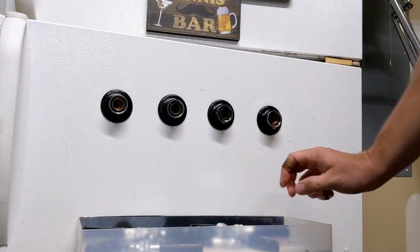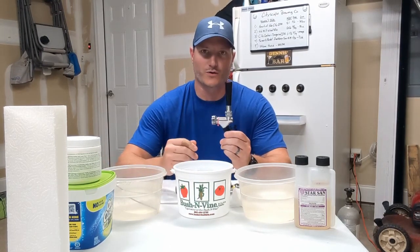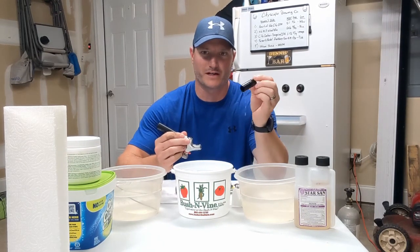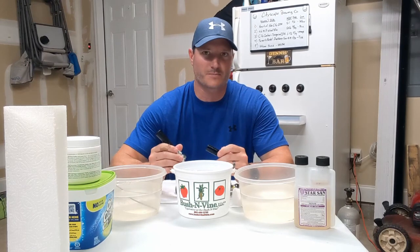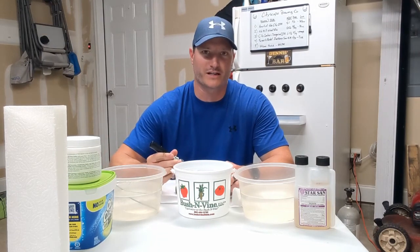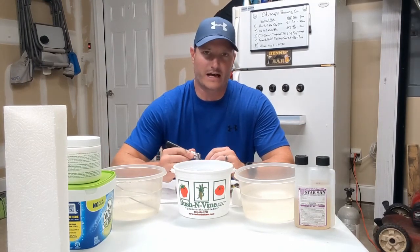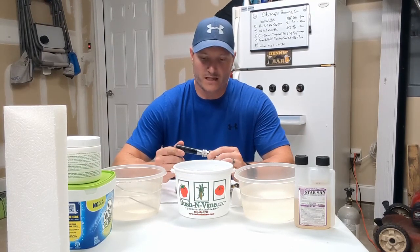So let's go ahead and start cleaning these up. Now that we got them all off the refrigerator we're going to start taking these apart. I use these little cap covers — they help keep little flies and other critters from crawling up into the faucets when they're sitting outside since this is in my garage. Sitting in the garage they're susceptible to getting mold or mildew, especially in the summertime. So you do want to do this pretty regularly to make sure you're not growing any nasties and eventually pouring a beer with that in your drink. I like to do these about once a month, a little more or less depending on the weather and humidity.